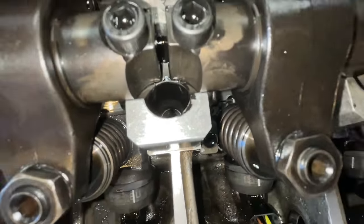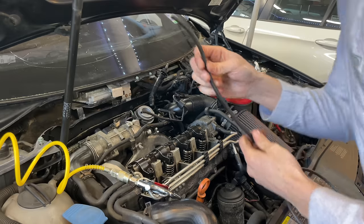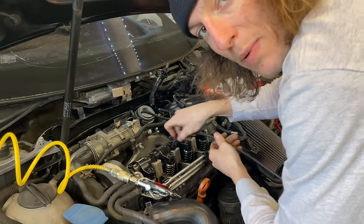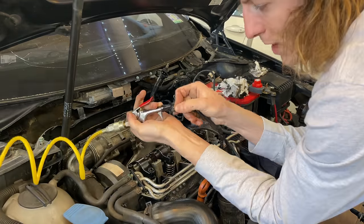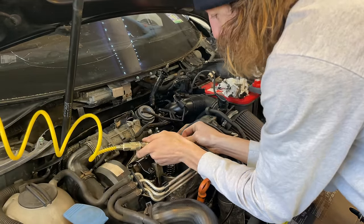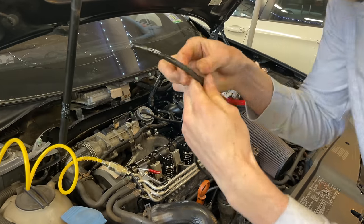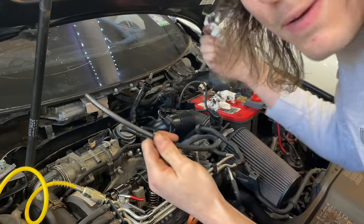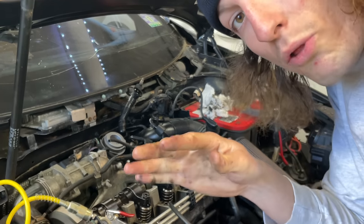If I didn't take it out with the paper towel, we would be in trouble. So I'm not messing around with this oil. What I've been doing is taking this air hose, sticking it all the way down to the bottom of the threads, the nozzle tip up to there, and blowing all that air down to the bottom of the threads. I pull this up and it's been getting covered in oil because it's shooting the oil back up. I wipe it, I repeat the process, and it gets literally all the oil out of the thread.